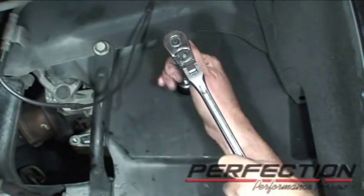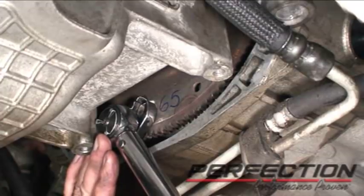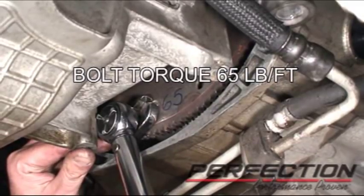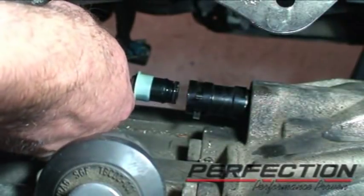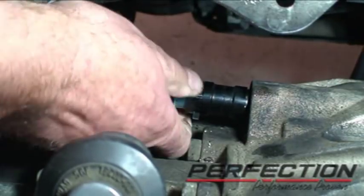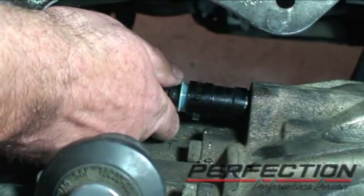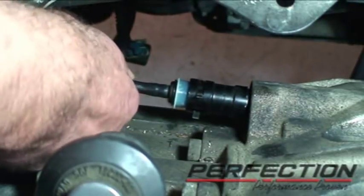I'm going to use the crank pulley to rotate the engine around and bring up the next bolt. It's pretty tight quarters underneath — there's not enough room for a traditional socket, so I'm using a crow's foot at 90 degrees to the head. With the engine blocked, give it a pull, got a click — 65 pound-feet. Now I'm going to connect the pressure line to the slave cylinder. Remove the little white dust plug — you don't need to remove the clip. I've got the new O-ring and new sleeve already in position. Just push it in and give it a little pull; you should hear that clip lock. Don't put your hand on the sleeve while pushing, because that can prevent the clip from locking onto the connector.